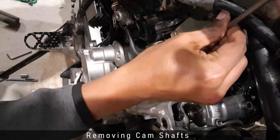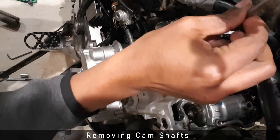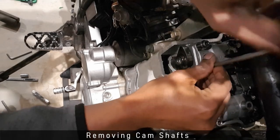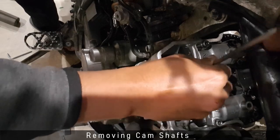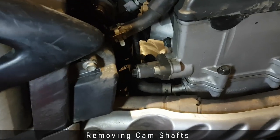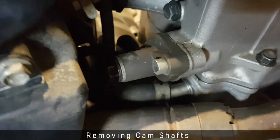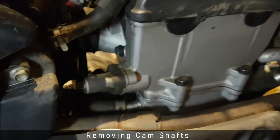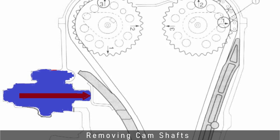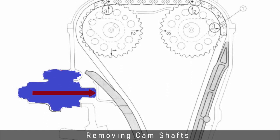I can now go on to fix the oil leak at the head gasket and base gasket. The first thing I do is make sure the head bolts are tightened to spec — if these bolts are loose there's a high chance oil could leak out. To reach the head bolts I need to take the camshafts off, so I undo the camshaft caps. Because I'm taking the cams off, I also need to remove the cam chain tensioner, which keeps the cam chain tight. As long as the tensioner is applying pressure the cams won't move, so the tensioner must come out before the camshafts are loosened.